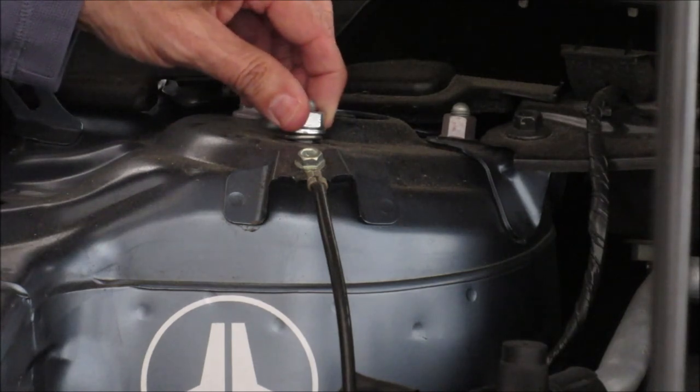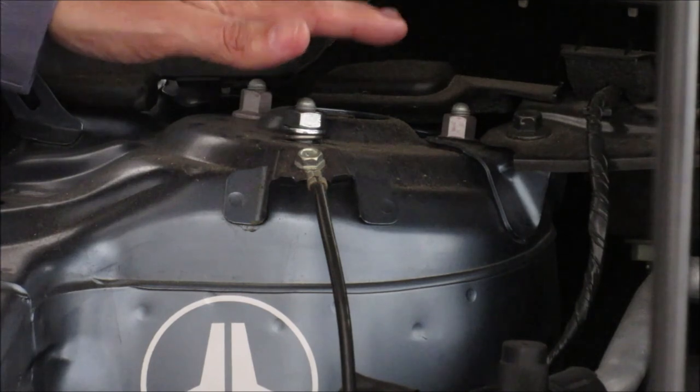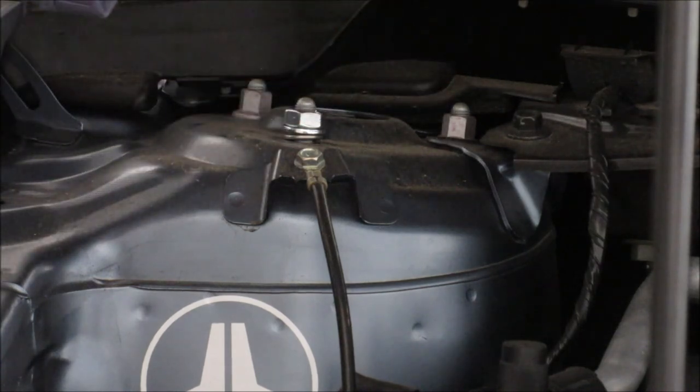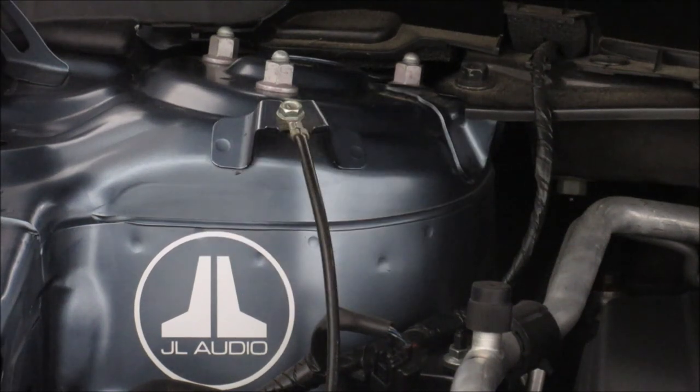The new hardware will allow you to tighten it all the way down onto the bracket and make sure it's held in place. From what I understand, it's easier to disassemble the mounting brackets from the strut bar, install the mounting brackets first on both sides, then come back to reattach the strut brace to the mounting brackets — that's the best, hassle-free way to do it.